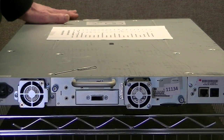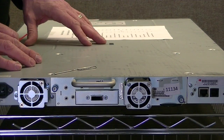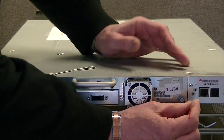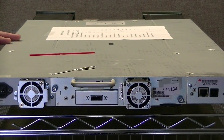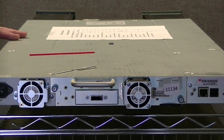You can access it without powering up the library or anything. The other side is a little harder to see, but it's next to the thumb screw and the little hole is right there. Then you pull the magazine out from the front. You can do that with the unit powered down or with it powered up — anytime you need to remove those magazines.